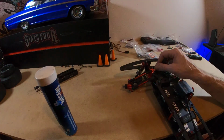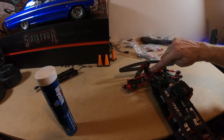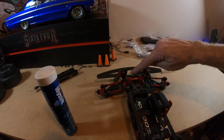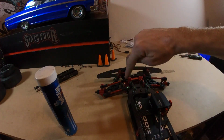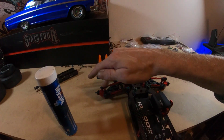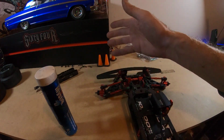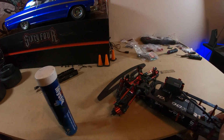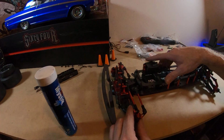And for the camber gain, you got to make sure that the whole position is as close inward or outwards to the position of the lower arm mount. And it's the same thing for the outside. So yeah, with that, that's mostly for the front suspension.